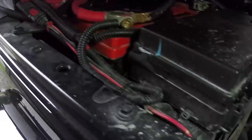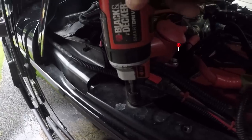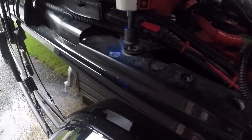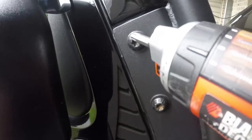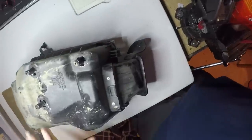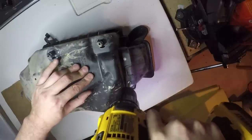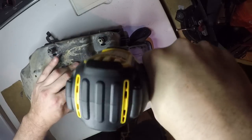At this point I wanted to prep the area and loosen the attachment points. We use the two rearmost points — one by the fuse box and one by the battery. My Genesis dual battery kit also uses one of these same points, so use caution that it doesn't slide when you let that bolt loose. With the air box mostly set, you need to drill out the factory snorkel rivets and remove it. They ended up spinning and cutting their way through the plastic, which actually widened the hole — so you'll see that I added washers later when I installed the new one.